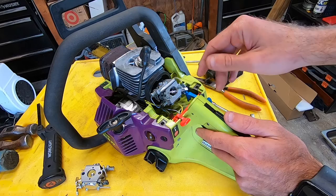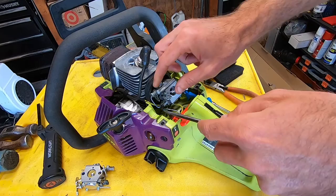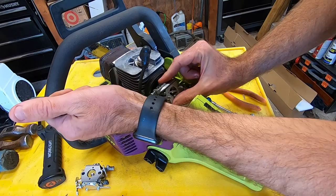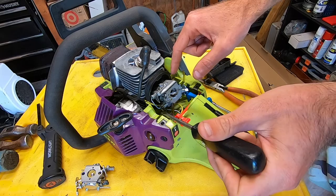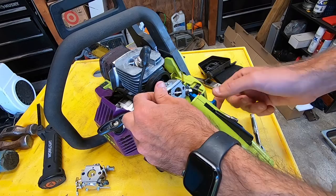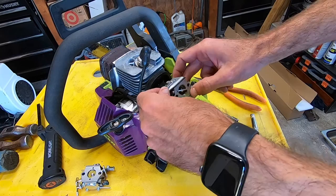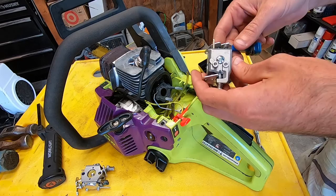There's a gasket that goes between the housing and the carburetor. Now what we are left with is basically just disconnecting the fuel hoses and the throttle linkage. On this particular one we just have a fuel line on the top and then we also have a fuel line on this side. This particular model has the lower hose on the left side and the upper one on the right side. With the two fuel lines disconnected, we can pull up the choke arm, pull it back off the studs, and turn it to get it off from the throttle linkage. At this point we have our carburetor removed.